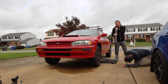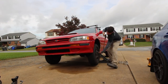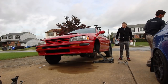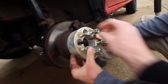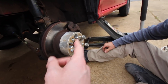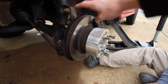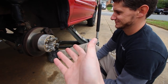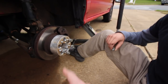It's already so hot. Alright, so the idea is that these bolts right here are going to go through and then actually get locked on. You can see how the threads are there, and then we're going to be changing over to these bolts, which are what's actually connected to the wheel. Separating the wheel from the hub like this puts a lot more pressure on the bearings and everything going on back here that keeps it rotating. That's why we normally don't use these at all. We don't recommend spacers, even though we tell you how to flush out fitment and stuff like that. We don't use them on any of our cars. This big is irrational.